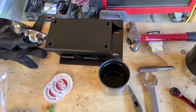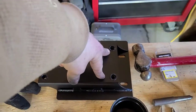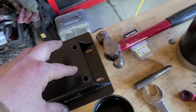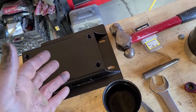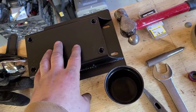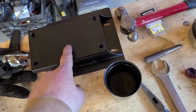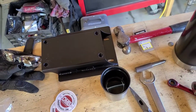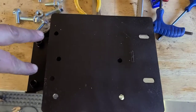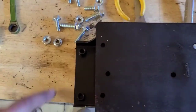Something else that I noticed that you might be able to try is these holes are for, say, a Clone or a Predator 212, are the same as these holes down here, right? So we could maybe line up just where the motor would be straight with the chain. You catch what I'm saying, guys? And we mark those holes, okay? Technically, that would work too, because that would be these here, okay, and those line up with these up top.